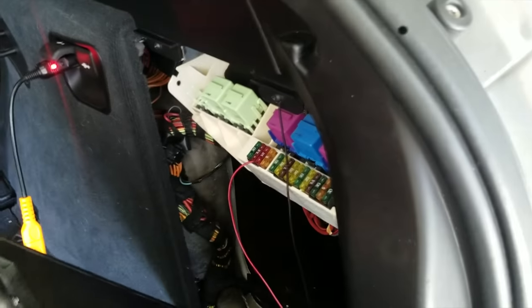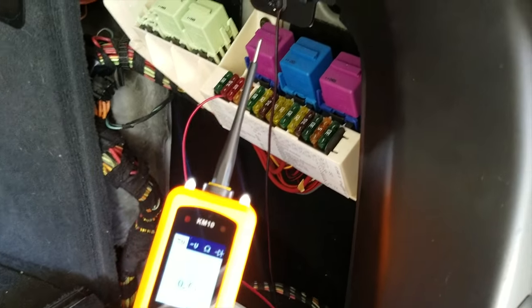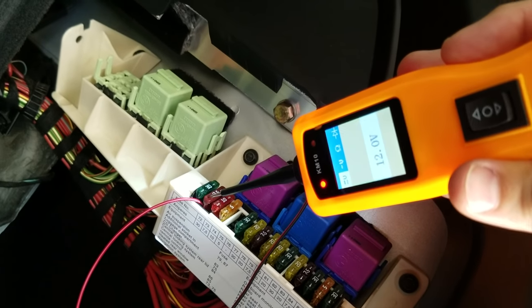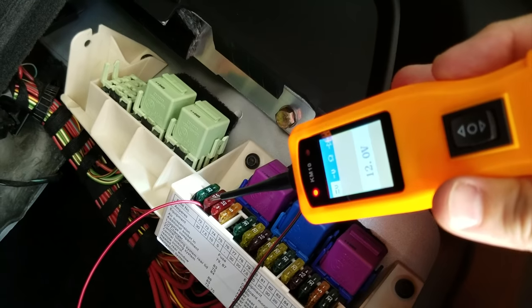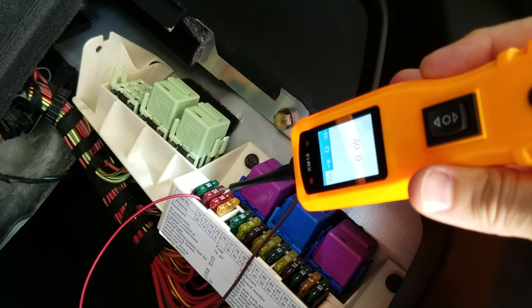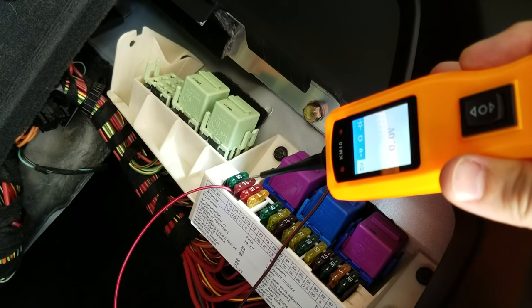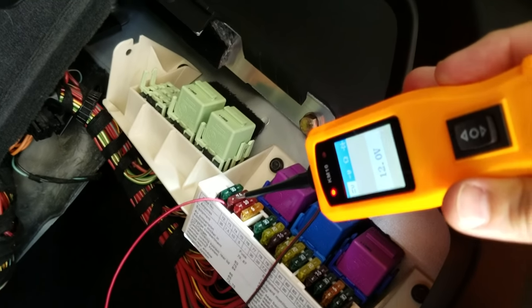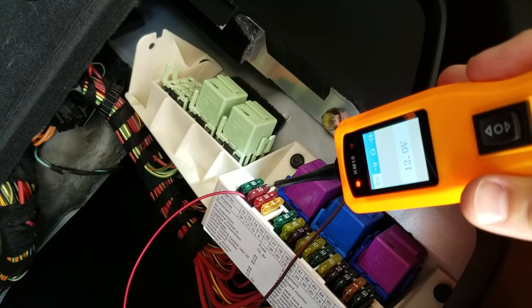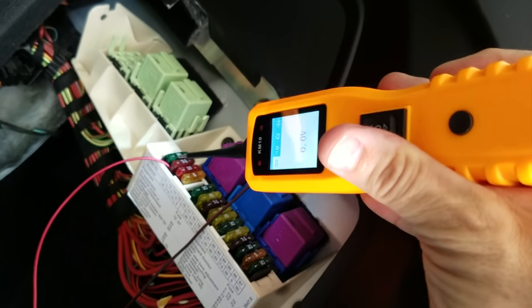Let's open up the panel on the 2004 BMW X5 and see what we've got here. These two wires were added later for the backup cameras. This connector is the radio — let's check the radio power. You can see on that side it's getting 12 volts, and on the other side it's getting 12 volts. Across these two you have a 7.5 amp fuse — reading 7.8 — so power is flowing from one side to the other. If the fuse were blown, one side would show positive and the other would read nothing. Don't push forward while monitoring fuses or you're going to blow them.